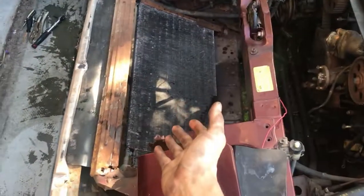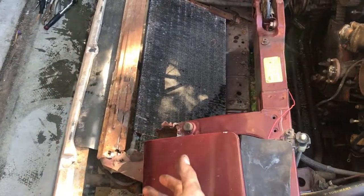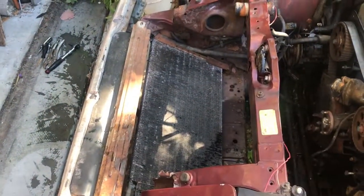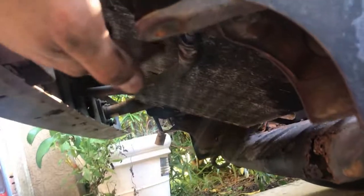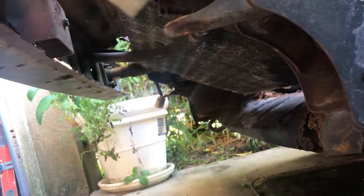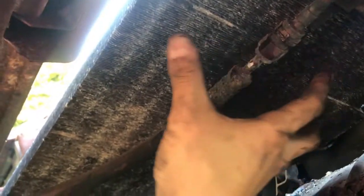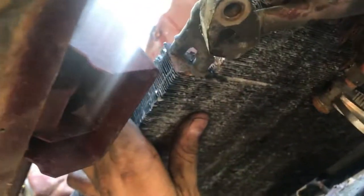Since this car has factory air conditioning, I want to preserve the condenser in the front. I want to remove it carefully without damaging it when I pull the engine out. Underneath the car there are two bolts that hold the condenser in — both 10 millimeter. The next thing to take off is this bolt and this compression fitting. After that, I'll be able to remove the condenser completely from the car. This bolt is 12 millimeter. I took the compression fitting off with a couple of pairs of vice grips — now the main line is disconnected and the whole condenser is free to move.